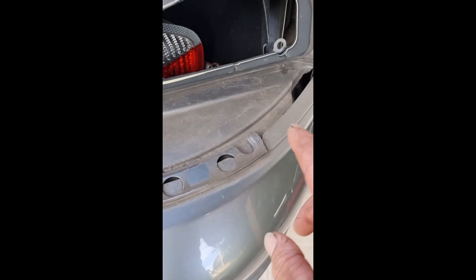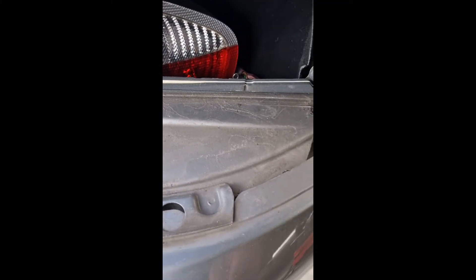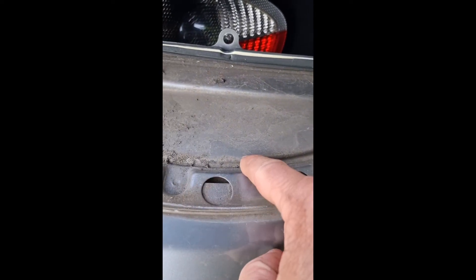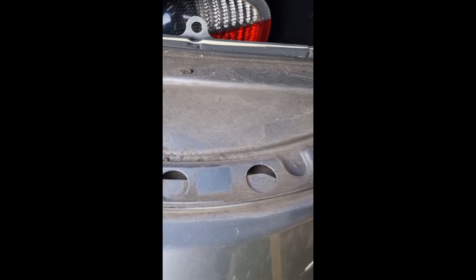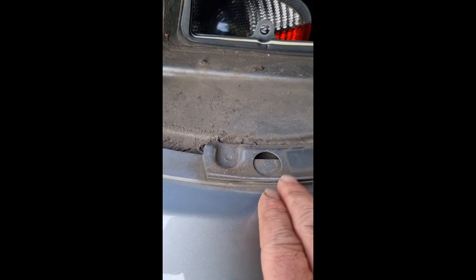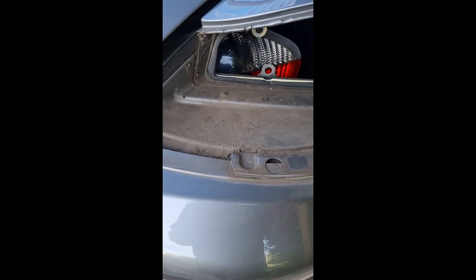On the corners, you've got two Torx fittings which are only quite tight, and then two little tiny Phillips screws up in here which hold the trim on. Sometimes the heat shield is tucked into this one, so I always take them out to be safe. I've taken the light out to show you how it fits in behind the light — you don't need to remove the light to take the bumper off, because once this fitting is off, the bumper falls out. But there's a little plate here which the bumper slides underneath, so when it goes back in it needs to go underneath this plate.